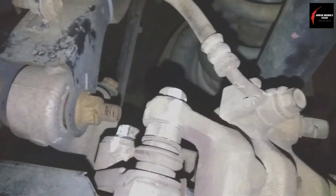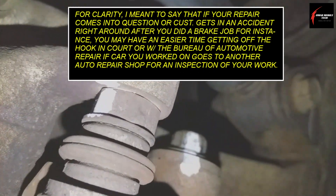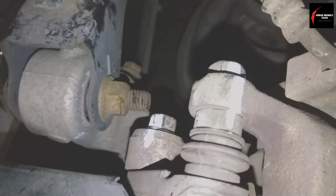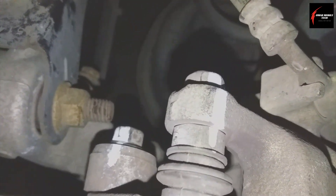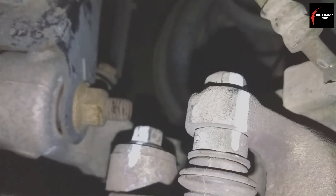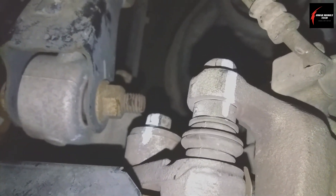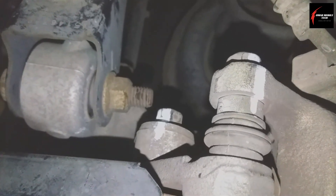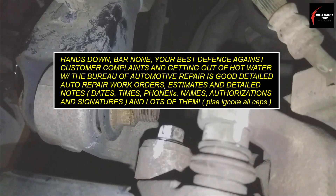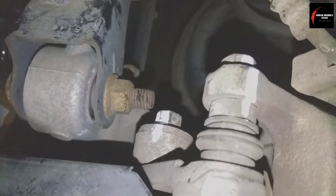Whenever I do a brake job, I mark all my nuts and bolts with a white paint mark to show that — if ever there's an issue with the repair and it goes to another shop — they'll see that I painted my bolts, and odds are they're going to take my side. In the state of California, there's the State Bureau of Automotive Repair that governs how people work on cars, licensing, and everything like that. They handle complaints from consumers and shop owners. They are the authority for anyone doing auto repair for money in California, and if they ever do an investigation and see that you've done this, that's going to help solidify their findings and lean more towards your side.